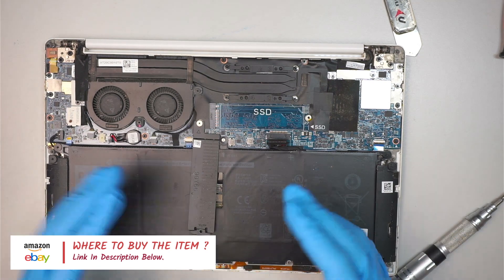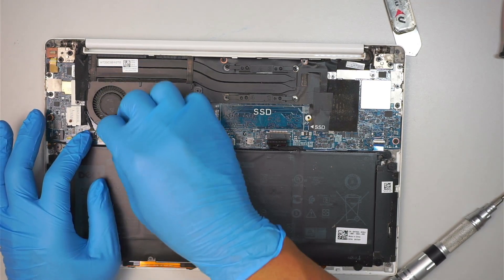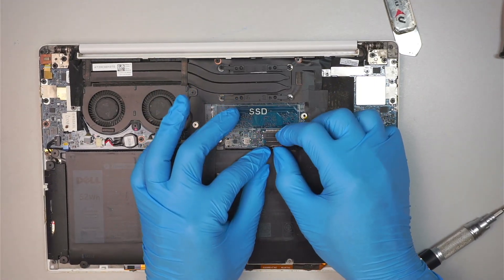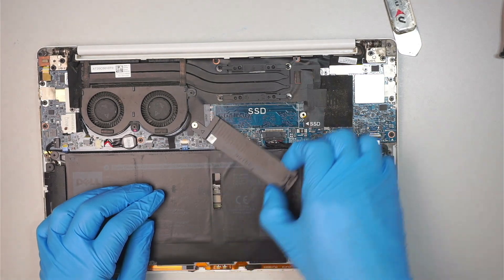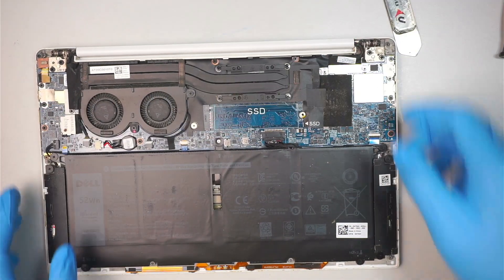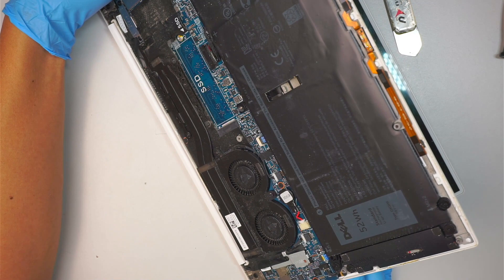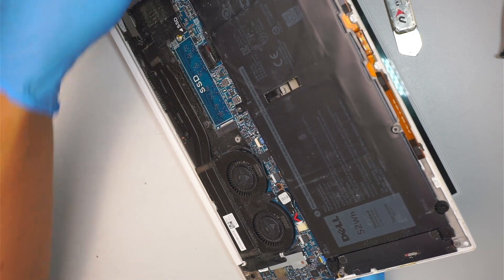It's been about a minute or two, so I'm going to re-plug in the CMOS battery, and at the same time plug in the battery connector — slide it in. As long as the fan spins and stays on, I'll be happy. Let's check the battery indicator — it shows full power. Pressing the power button: again there's just a little light that comes on and goes away, and the motherboard fan is not spinning.